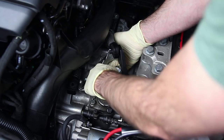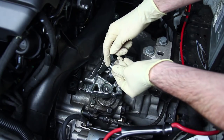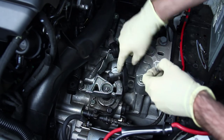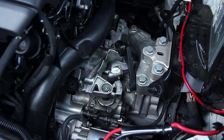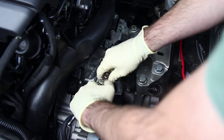We're going to pop that up. All you have to do is spread it and then pop it up. What you're doing is getting these detents spread open this way and then just pull it past, and then you can slide this out like so. Now we're going to loosen our 13mm that actually mounts this in place.